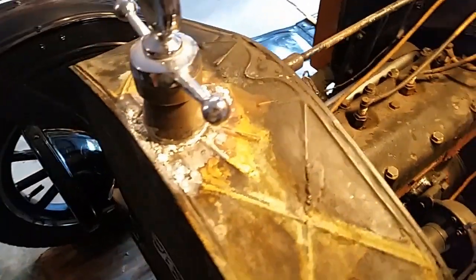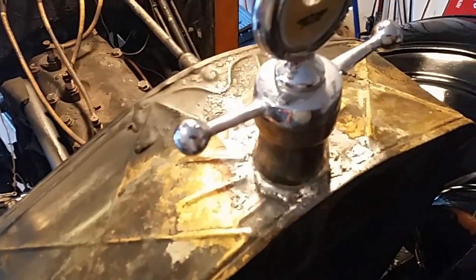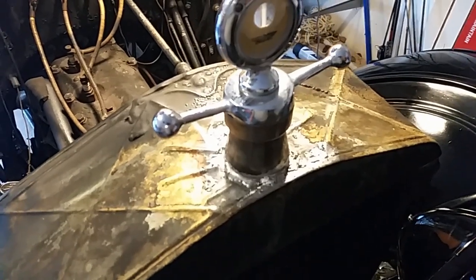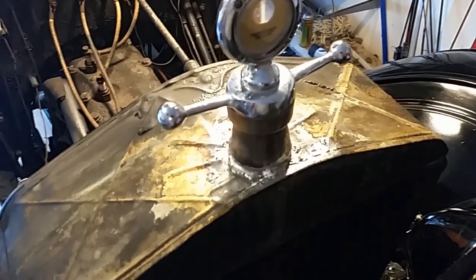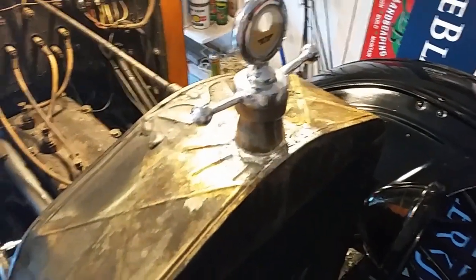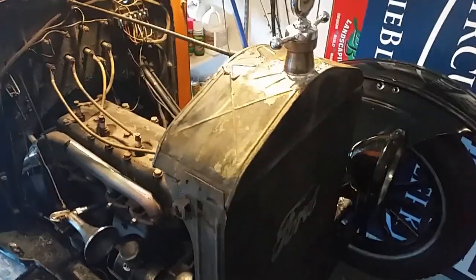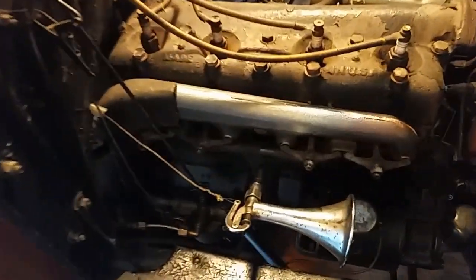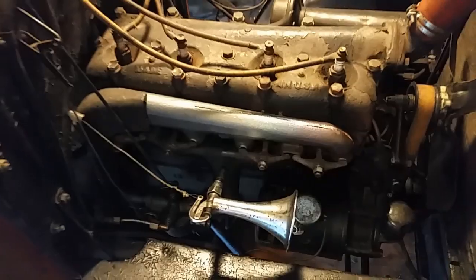There's the solder job — it's really ugly and it still leaks. We're going to put some epoxy on it because the top tank is cracked and split going in several directions and we're having a really hard time sealing it up. We're probably looking at getting a new top tank put on. The manifold came out well though — it's all tightened up and doesn't leak.